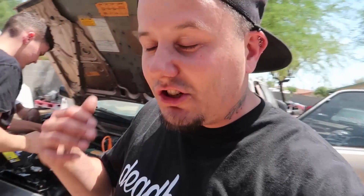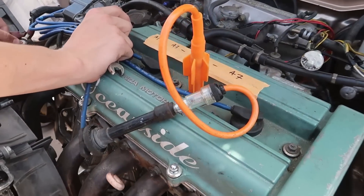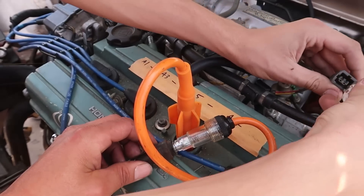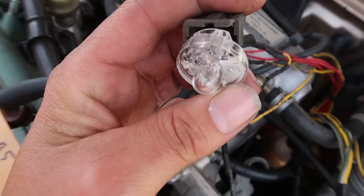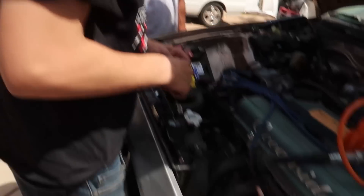I don't know what's going to do that. I think what we're gonna do is go through the pinouts for the distributor and see what's different from the PR4 to that ECU. Since the injectors are firing, the wiring must be right in some kind of way. I'm going to go through the pinout differences and maybe that will be a big red flag - like this ECU has these wires configured differently for fuel injection versus the PR4. Then I can apply that to the PR4 and hopefully everything will work. I think this is a step closer.